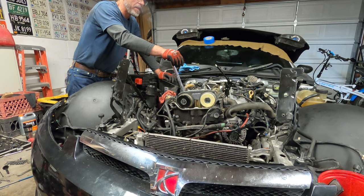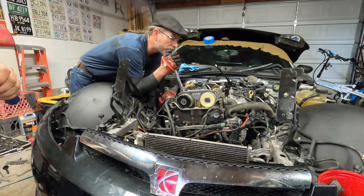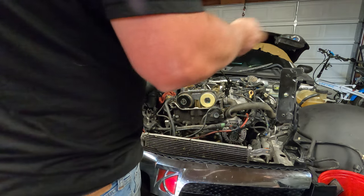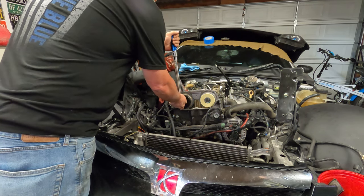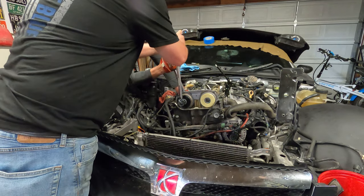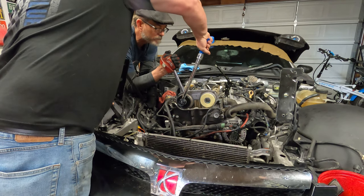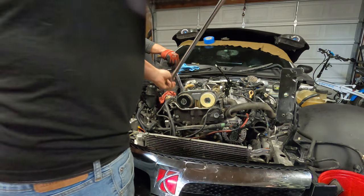Yeah. You know what? You want to put a bigger... Yeah, you need a bigger one. I don't know. You've got to hold it. Well, I can hold it. Well, let's try this side. The book does say... Did you do this one torque yet? No. That's why... 22 foot-pounds. There's 22. 100 degrees.